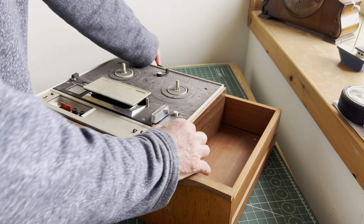Power on. There is a noise coming from inside — don't know if you can hear it. We'll turn this to the play position. Turns and then stops. Rewinds and then stops. I think what we're going to do is take this cover off if I can, see if everything's okay inside there with the heads and things, and then I plan to put some spools of tape on and see if it'll play through.